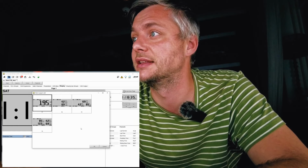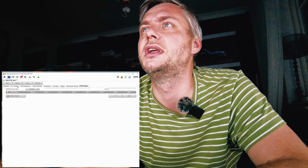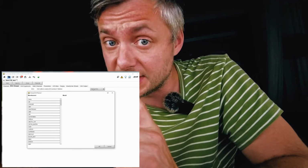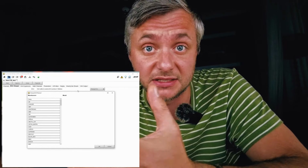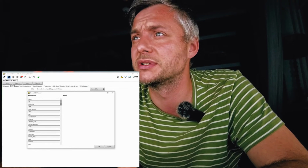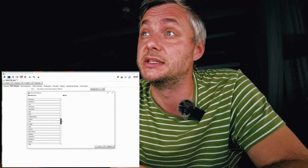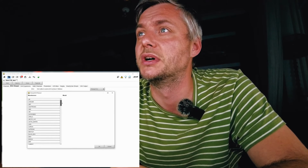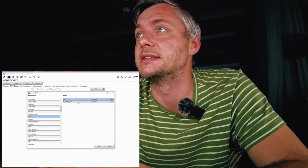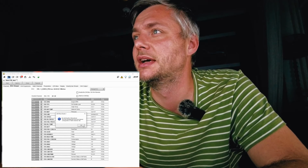So I don't think you really need anything else. Hopefully this explained stuff. Then what you really need to do is change ECU. This is very, very important, because obviously the AIM doesn't really know what ECU you have, and you need to tell it, because all of them have different protocols. It has a really extensive list of ECUs. Mine is DTA Fast S60 Pro, so we can look for it here, and it's DTA S Series, S60 or S Series Pro. I can't remember exactly which one I picked, but I think it's this one.